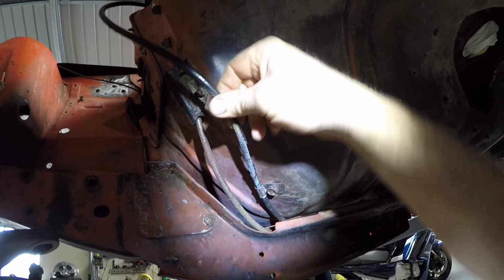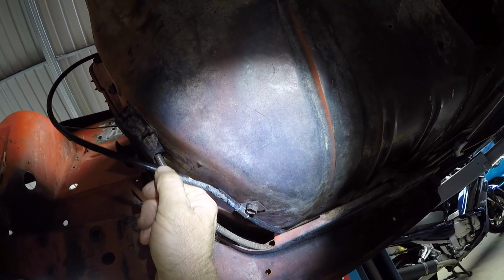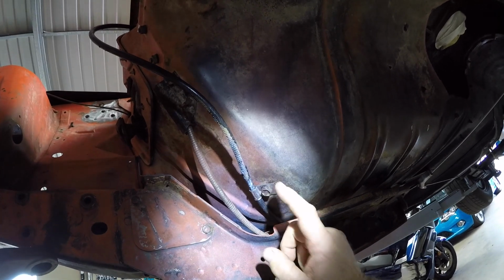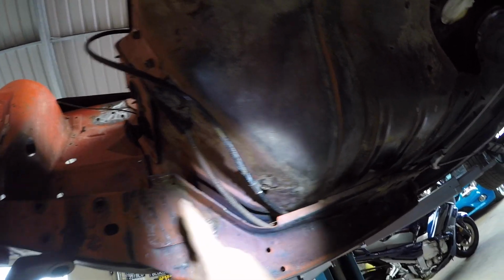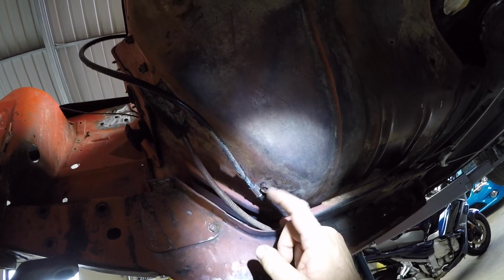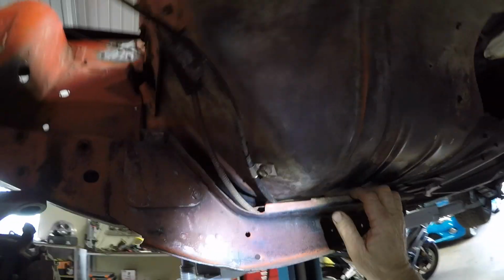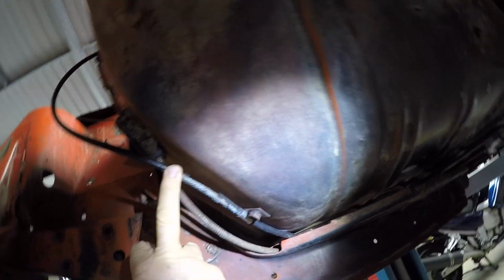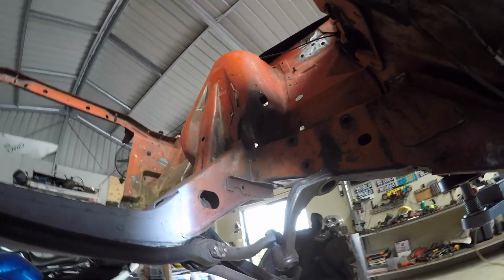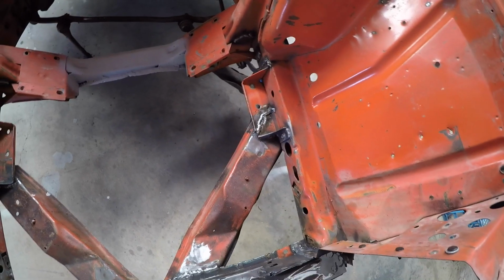Speedo cable. I think what's happened here is, I know what's happened here. The extractors obviously are creating a problem for this. So I'm going to reroute that somehow so it's well and truly on the other side of this. So take that anchor nut out there, weld that hole in, and bring it on the other side of the park brake cable, because clearly that's been destroyed by heat, nothing else. Anyway, we'll keep going. All right, I've had it with seam welding.